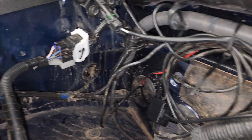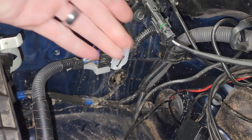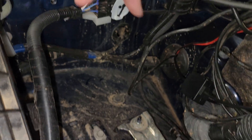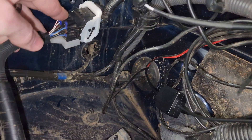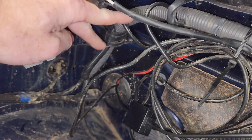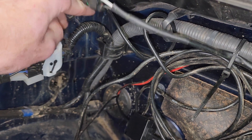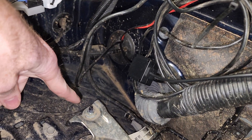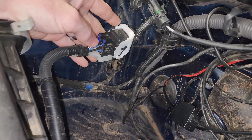We're over at the 4Runner. I need to do a couple of things — I don't know if all 4Runners come with this, but mine's a 2020. This piece needs to be relocated because the wall of the ICS Fab tray is going to go into that hole and that hole, and then get held down by that nut. To relocate it, this plastic trim right here is a holder for the main harness. This piece comes up to here, so I'm going to unclip that — it gives me slack to tuck it down. I'll zip tie it around there, take that nut loose, and then set the tray in.